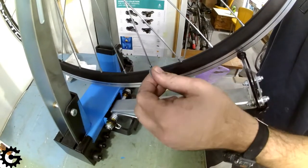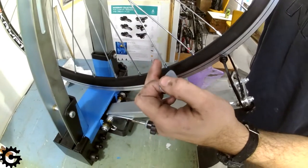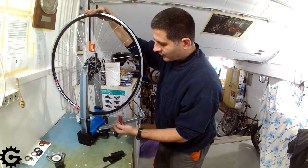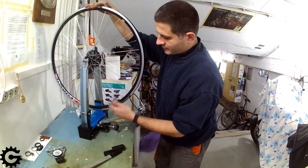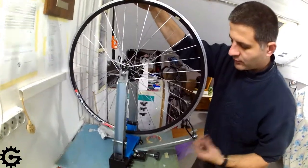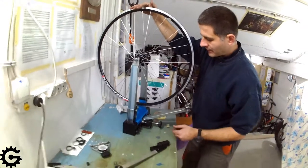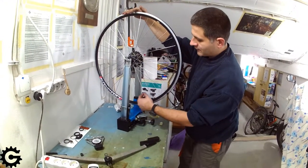The sound difference is rather large for a little difference in tension. So this is an easy way to check for relative tension between spokes on the same side of the wheel, but it will not give us any information about each spoke's absolute tension, which is important for some rims, since most rims have a limited tension take from all the spokes combined together.